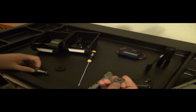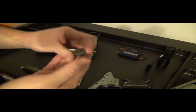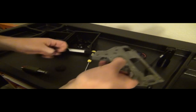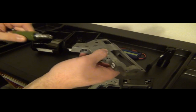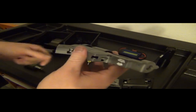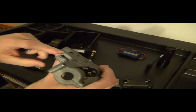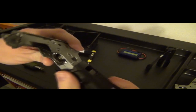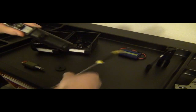In a parallel test, it's hard to hold the gearbox. Let's say this is your gearbox. It's hard to hold it straight, put your motor and grip and everything on there, and just see how parallel it is. The way you want to do it is put your gearbox together and see where your pinion gear is. So for instance, you can see here, this is closed, and you can see where it is, and you can do your test here.